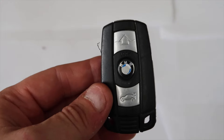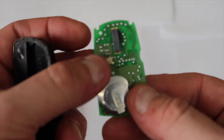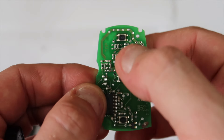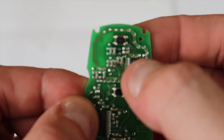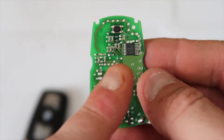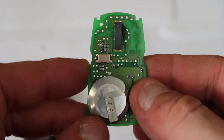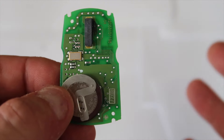Here's another key that I've already opened up. You can see the transponder inside. When you cut these open you have to be very careful not to cut the transponder itself. On the back you've got your door buttons — unlock, lock, and trunk release. That's the EPROM on the transponder, which you register to the car. It links up to the CAS and stores all your EPROM data, linking your CAS to your key. Many people ask if you can reuse keys — yes, because I can delete old keys and make them blank again, or unlock locked keys.